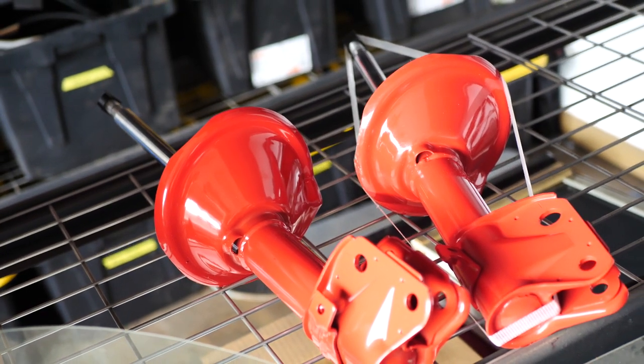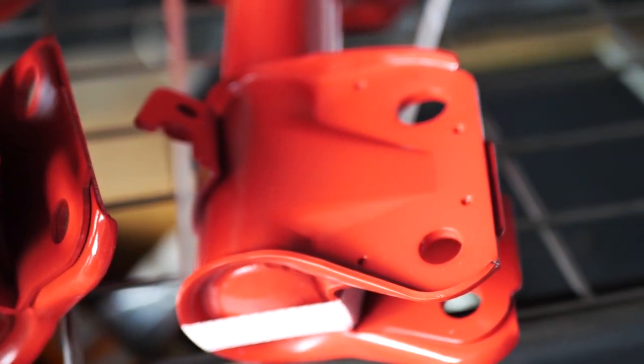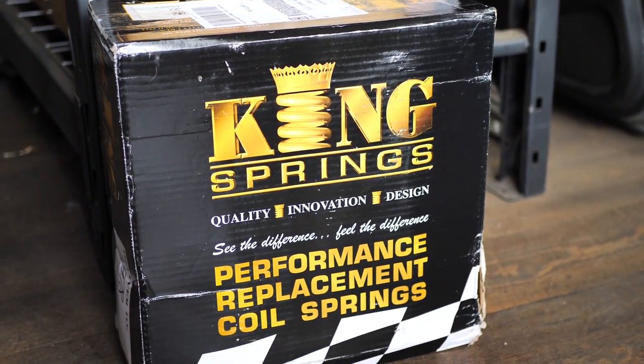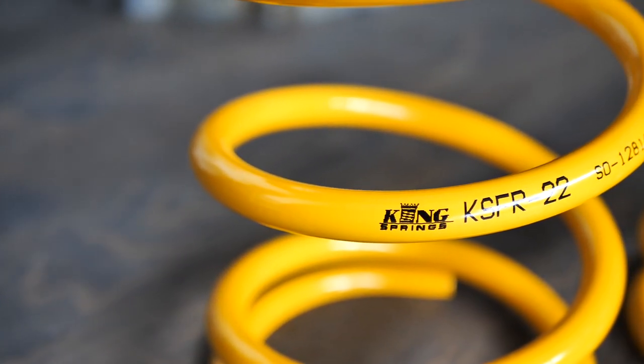After that, we've got some awesome stuff. We have some new front suspension - we are swapping the Forester struts out for adjustable WRX STI struts, so the dampening is going to be adjustable and stiffer, but it's gonna lower it two inches. To raise it back up, we've got new King off-road springs - rallycross springs that are one and a half inches taller than stock, with a stiffer spring rate, better travel, and lighter weight. So the front suspension will lower just about half an inch, be a lot stiffer, adjustable, and match the rear. We're also going to be removing the lights and getting the new headlight and blinker setup situated. Let's go ahead and start painting the control arms and doing the front suspension.